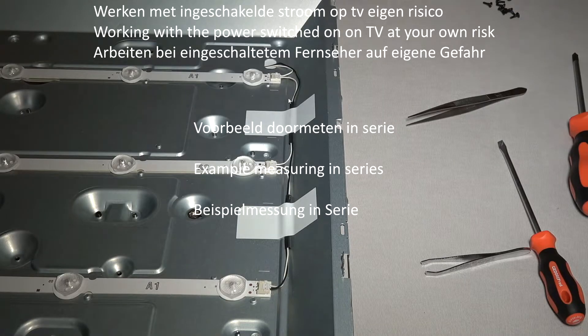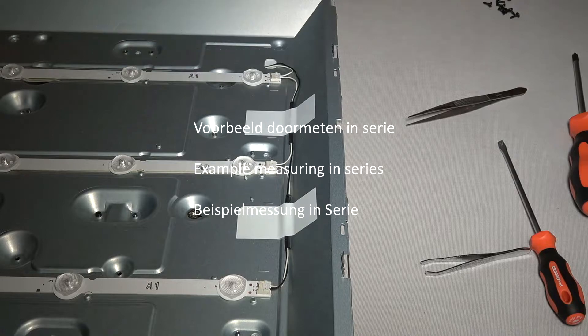This is the scenario when the backlight is wired in series. You see here two wires from the TV coming out. That means if you measure across the backlight connector, you see the voltage. If there is only a small voltage coming through, or a number that seems off, then the TV is simply not sending the expected signal — which doesn't necessarily mean the backlight itself is defective. There may be something wrong with the circuit board, a capacitor, or something else. It's just a tip for diagnosis.